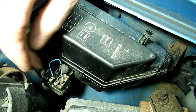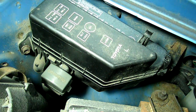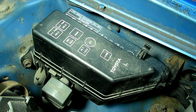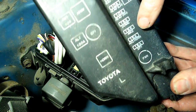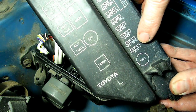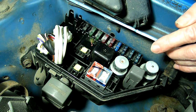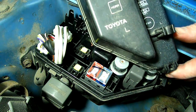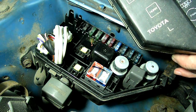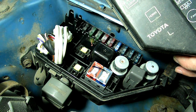After you've done checking the codes, remove your jumper and close that, and now you can turn the key off. To turn off the check engine light after you've done a repair, you want to remove the fuse box cover and look for the EFI 15 amp fuse. Remove that, wait at least a minute, put it back in, and that will turn the check engine light off. Now if you happen to have a vehicle with a carburetor, look for the fuse for the radio — do the same thing, remove that, and it will turn the check engine light off.